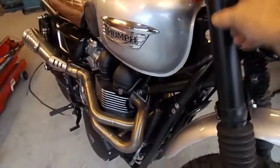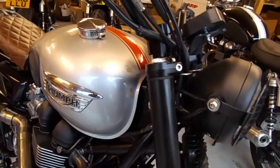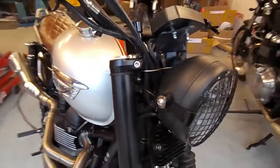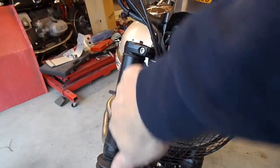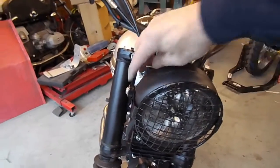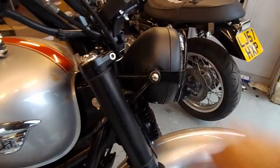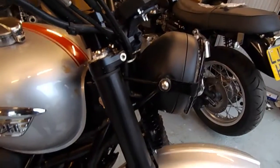I've made a couple of stainless steel tubes, cut them to length and welded a small stainless steel tubular bracket on, which we've painted satin black. The reason I've put these on the inside is the standard brackets tend to be set up for a seven inch headlight. This being a six and a half inch, the brackets need to be spaced and they don't look quite right. So I made these up as one of the few non bolt-on items on the bike, just to be a little bit different and neater.